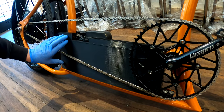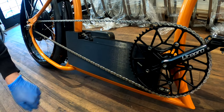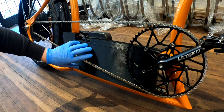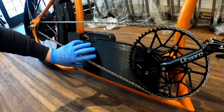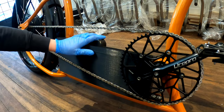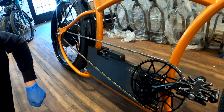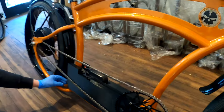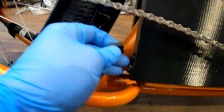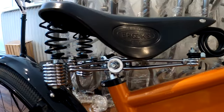We don't want to fully max it out, but we also do want to suck all that tasty power out of there. So this, of course, can produce as much power as you need to this back motor through this controller, which is pretty much maxed out. So that's how you're getting the top speeds. And then on the back side here, we've got the charge port. I made just a blank plug to keep it clean, so between charges, you don't get any dirt inside.